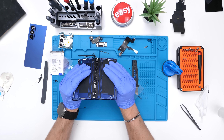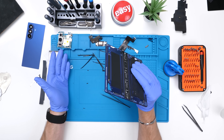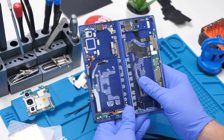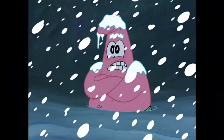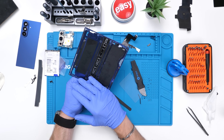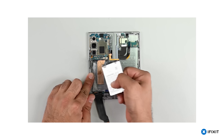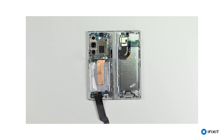It doesn't really give as much as I thought it would, especially with all the internals removed from the actual housing. But this phone is missing something — the cooling. There only appears to be a graphite film under the inner display and a thermal pad under the motherboard. No vapor chamber like the Z Fold 6, which might be an issue.